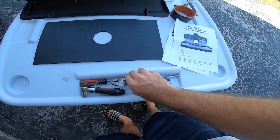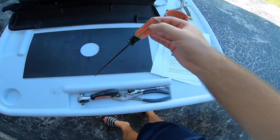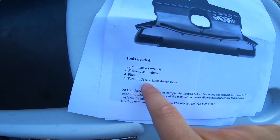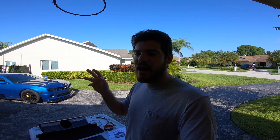The tools you'll need are: a pair of pliers, a 10 millimeter socket wrench, a flathead screwdriver, and a fourth tool — an 8 millimeter driver socket or Torx T15. In my situation I didn't really need that last one since I already have an aftermarket intake, but if you have a stock factory intake, I'll show you where you'd need it.